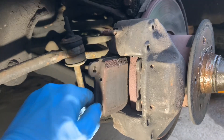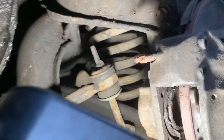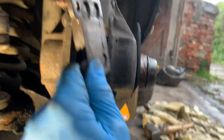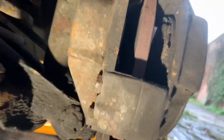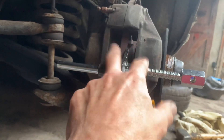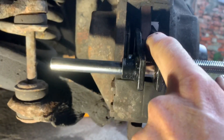This pad is so hot. What often happens is that the calipers or pistons inside don't move in and out freely. That one came out okay, so I suspect that's not the problem. This one here might be slightly trickier — it's coming out as well. Once again there's a whole load of gunk in there, probably a big rubber seal. I happen to have this brake piston caliper separation tool that, when you wind it in, forces the pistons out. I've clamped it onto the disc, and now I'm going to put my foot on the brake to squeeze the pistons.